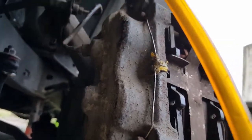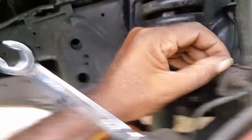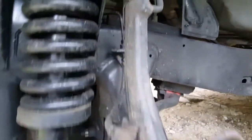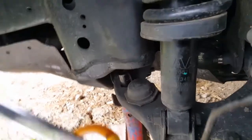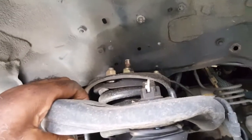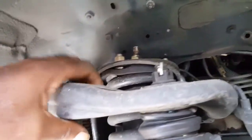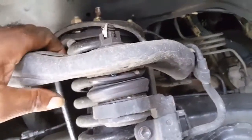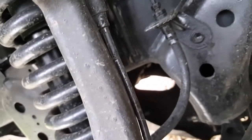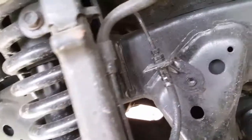Then this is the cable for the speed sensor — you would take it out and disconnect it from here. There is a clip right here which you will take out, and take out the brake line. Take a piece of tying wire or whatever you have — once you take out the caliper, you'll put it up and tie it. Do not let it hang on the brake line; your life depends on it. Don't kink the brake line or anything — you would hang that portion.